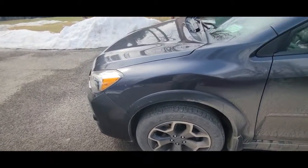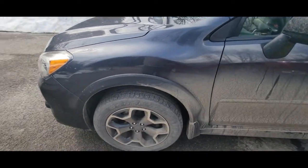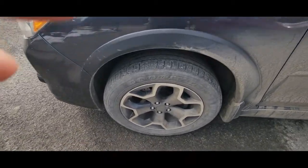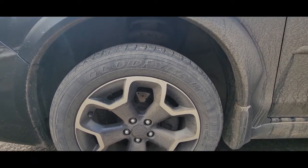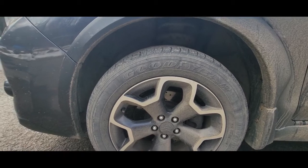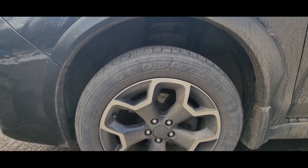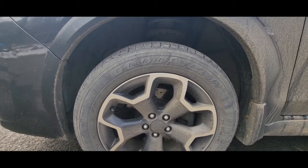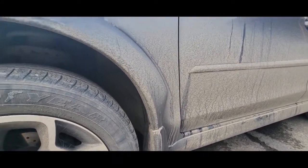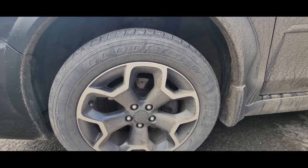We got grandma's race car back here — the 2013 Subaru Crosstrek. When we did brakes last time, I tried to get better rotors because they didn't last very long. She's rough on brakes, probably from not driving it. Up here in upstate New York the road salt causes the sliders to fill with rust, which overheats the rotors. She's only got 60,000 miles but this looks like a third set of brakes — they go about 20,000 miles.